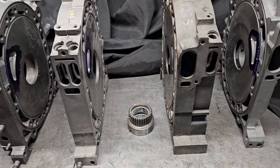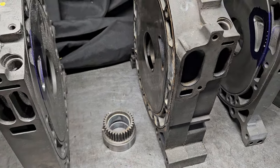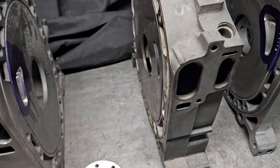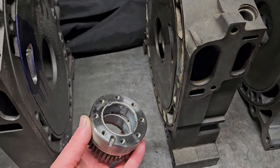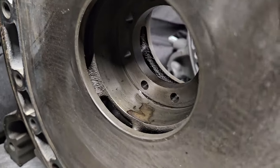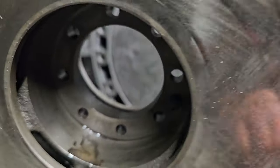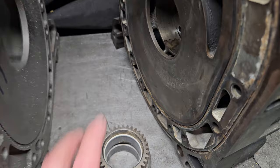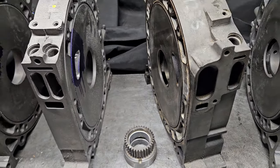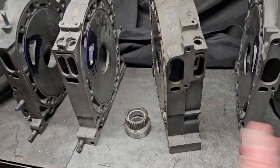That thick plate and gear are very unique. It does not have any backing on it — it's actually bolted in with smaller bolts from the backside and has a land that you're going into, and a set pin or alignment pin, which is going to orientate the gear for your rotational alignment of the rotor. So it's not just as simple as grabbing your 13B center plate and putting it in there, making the stack longer.